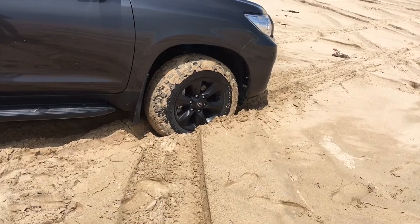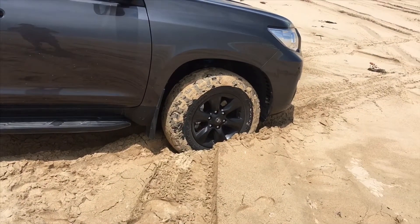When you let the air out it spreads the flat part of the tyre — spreading your footprint. So if your footprint's double as long, you've just divided the weight of the vehicle on that tyre by two, so that's half as much pressure. You're only going to dig in about half as much.